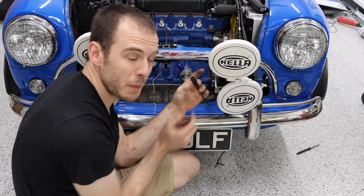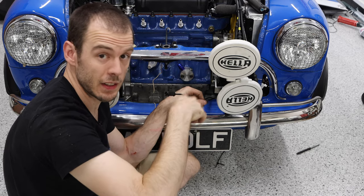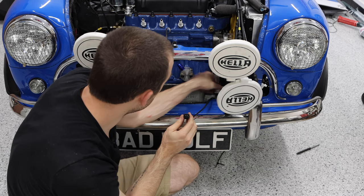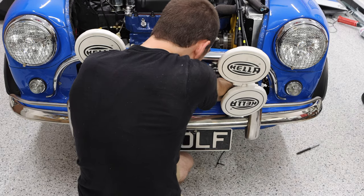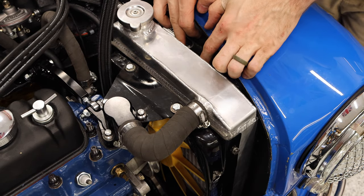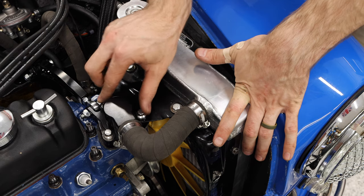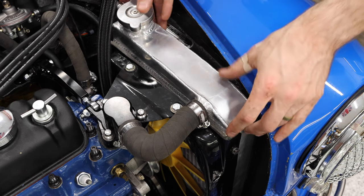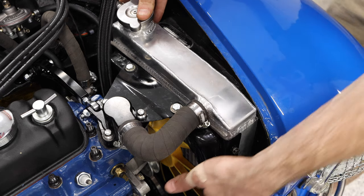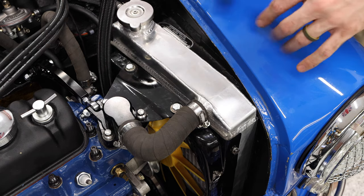What I'm doing here is plugging in my crank position sensor. I'm running the sensor wire down behind the back of the radiator and underneath it near the engine mount, then plugging it in — I can reach that plug easily from the front, so it'll be up and out of the way. Now this radiator is literally touching the shroud on one side, so I'm hoping I can loosen up these bolts a little, push the radiator just a smidge so it's not under so much stress, then tighten the bolts back down. If that doesn't do it, I think I have enough play in the bottom of the radiator bracket to notch in a little bit of space.